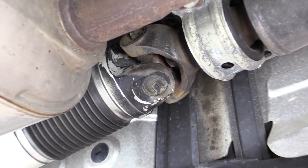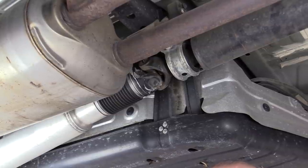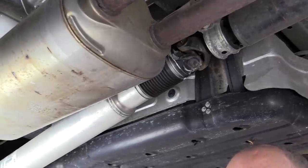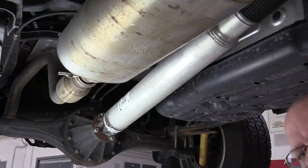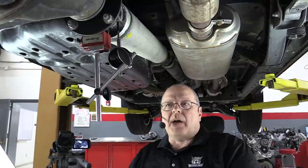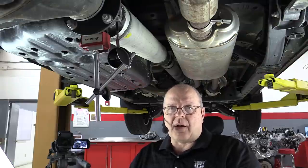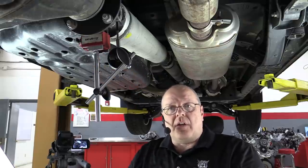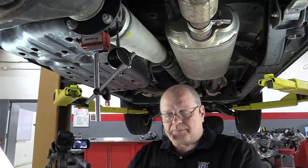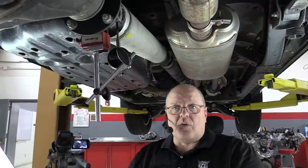The last thing to do on this drive shaft is take measurements. There's a measurement called axial play that can be taken on every U-joint. I want to take that measurement on the rear U-joint on this truck. I've got the dial indicator with a magnetic base connected here at the rear U-joint. There are two axial play measurements and a radial play measurement. Axial play is the up-and-down play in a U-joint; radial play is the twisting motion that everybody is used to checking. There's a specification for both — just under two thousandths of an inch from Spicer on these U-joints.